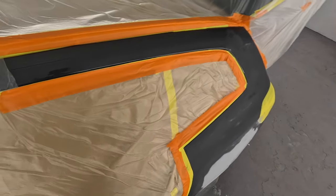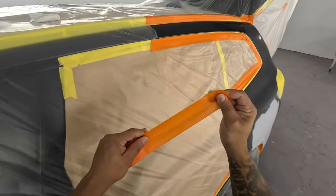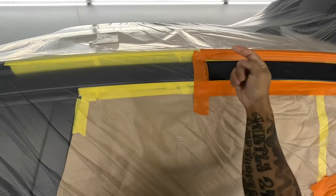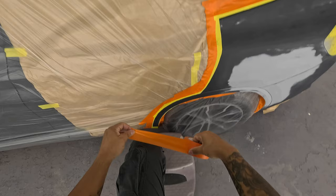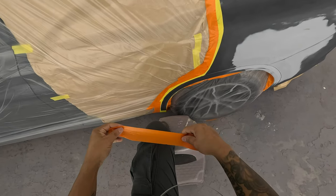This really isn't part of what I do when I do my blends, but I saw some little white spots that were on there so I just took them off real quick — nothing big. Then I start with two-inch tape to seal that off completely. I don't want any kind of loose vapor spray getting under there and getting on the rest of the car. Make sure it's masked off completely. I'm sure you guys have seen what happens when it didn't work — start over.